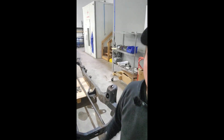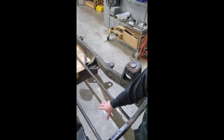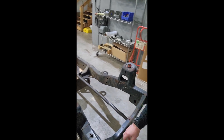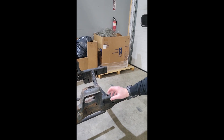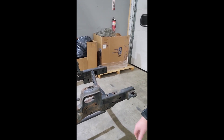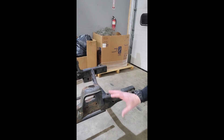Here I wound up taking the frame out. Originally when the frame was still on the body I had cut off a lot of the original lower suspension stuff. We saw the strut towers here and they're actually going to wind up going away. My thought is — doing quick measurements — the front suspension is going to be a 2010 to 2015 Camaro. It's a strut-style three-link front suspension: two bars on the bottom and then your steering tie rod.